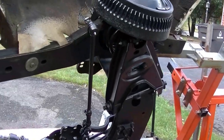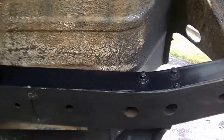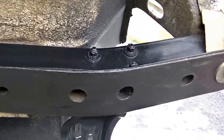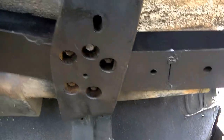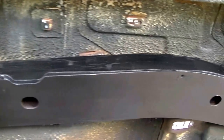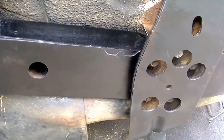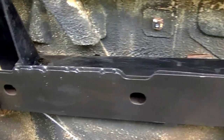We're in progress of cleaning up this frame. This section right here I just cleaned up with some brake cleaner and a Scotch-Brite pad, real light, and factory paint. I did just a little bit of touch-up with some black lacquer, and that came out nice. This section just took a wire brush and some Scotch-Brite and cleaned it up. There was a lot of factory paint still there too. I did use the rust converter on that, so you can see now it's dried. The Dupli-Color rust converter turns to a black primer.